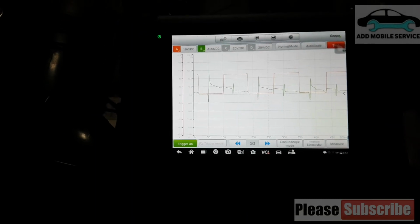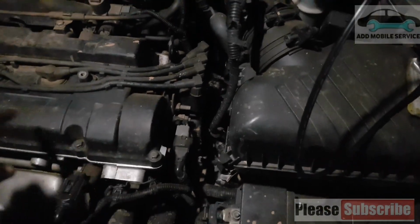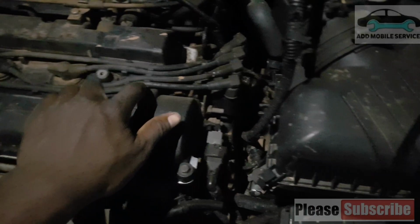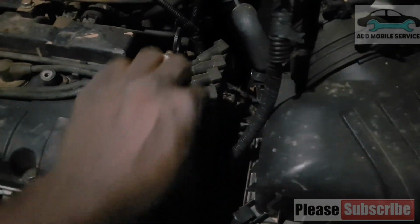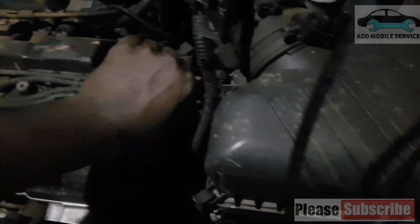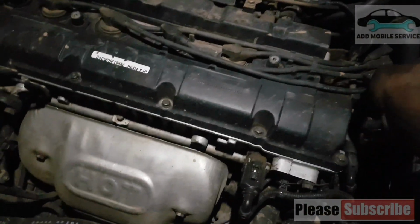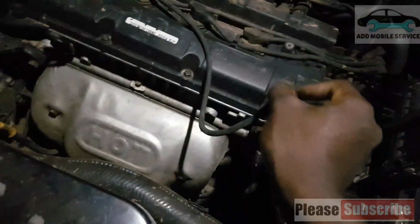Thank you for watching. After using the scope to detect the misfire and that ignition coil 2 is not working, now I trace to the ignition coil and take it out. Let me turn off the engine. Now I want to know if it is from the cable.